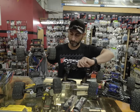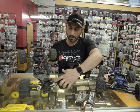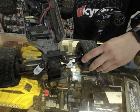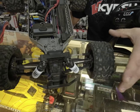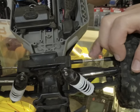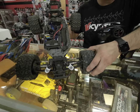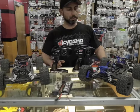The VXL also includes a wheelie bar — worth about $20 — and another big thing is the linkage: all the turnbuckles are adjustable, so you can really set your camber and toe. That's how you can make your car handle a lot better. Having all these metal turnbuckles is very nice; it helps a lot when you start racing on a track or just want better handling beyond what you get out of the box.